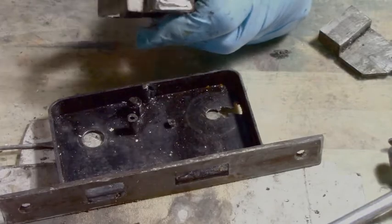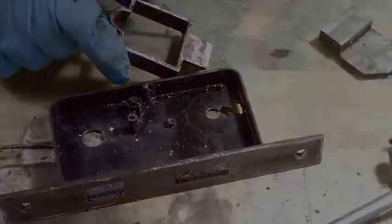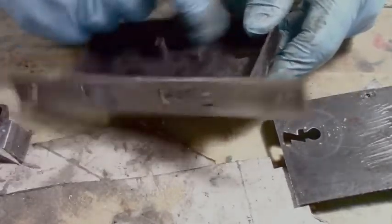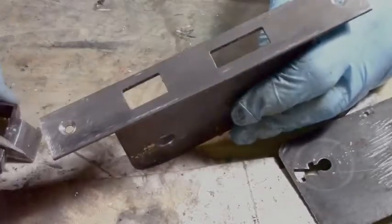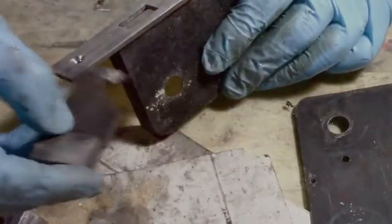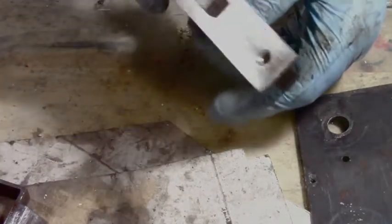Right, so just scratch the paint off a little here and that. Clean this up a little more. Wash out a little more, we're ready to go. We'll put her back together. A little tip is, you can leave a little black in here, whatever. I've cleaned it pretty good. There's a little dust in there, but it won't kill anything. But you want to do the strike front here nice and clean. This latch nice and clean, and the front of the bolt nice and clean, because it'll all show afterwards. And that's what you want. You want to keep everything. Let's get that in there. There. You want to keep it all nice and clean in the front here, so it looks really nice.